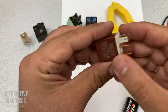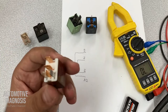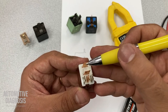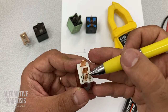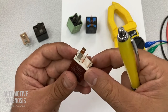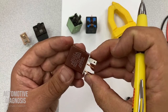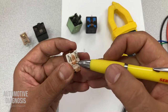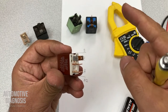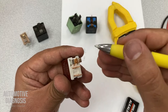The other one is the five-pin relay for Toyota. For the five-pin relay, we have another pin. We have the same two pins for the coil, two pins for the switch, but we also have another switch in there as well — so we have two switches. On many five-pin relays, one is normally closed and one is normally open. This relay bridges power from 30 to one circuit when not energized, but when you energize it, it stops providing power to that circuit and starts providing it to the other one.